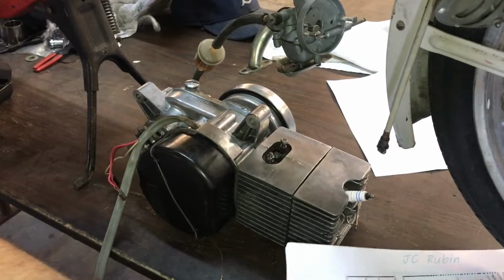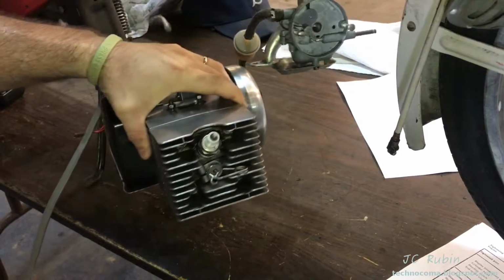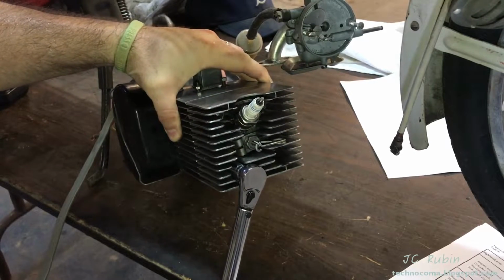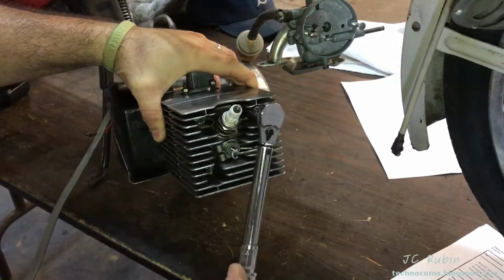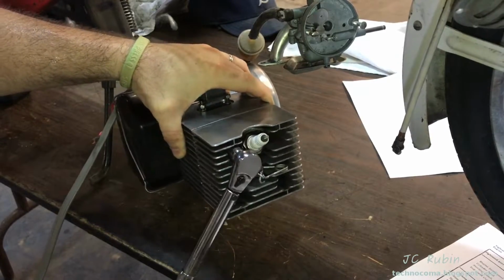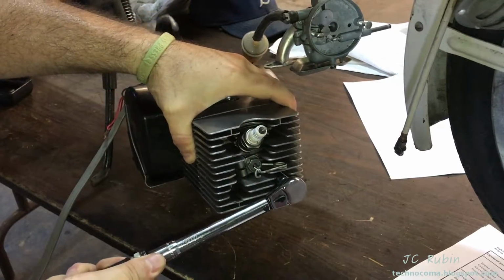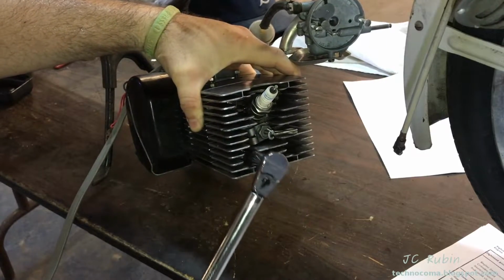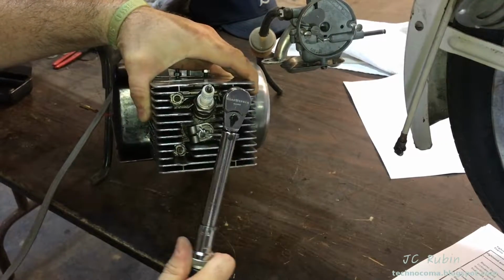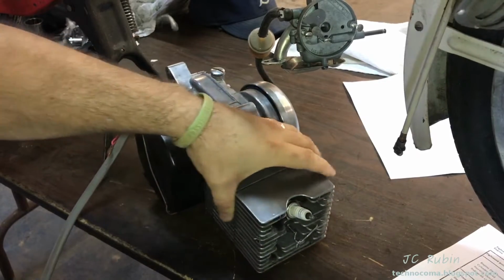Nice. I found another manual for the 210, calls for a final torquing of the heads at 7 Newton meters. I'm happy to oblige, so I've set up my torque wrench accordingly, and we're gonna cross torque them for 7 Newton meters. And I'll revisit them one more time because it's aluminum. Make sure that there's still 7. There you go. I'm gonna call that torquing done.